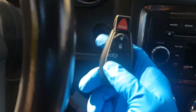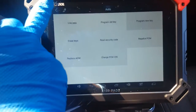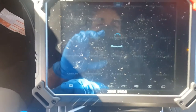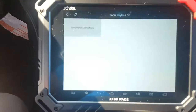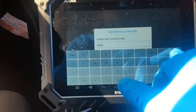Okay, we're gonna pull that out - let's check our buttons. Alright, so we're good. Now we're gonna plug it back in. On this one guys, it doesn't have the key fob option under Dodge, but it does under Jeep. So we're gonna back all the way out and go under Jeep, agree. Fob key - let's go. Synchronized smart key. Okay, we already removed the start button, inserted the key, press okay - our security code is 2339.